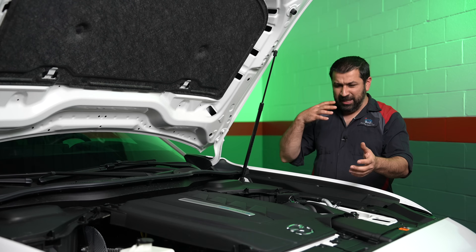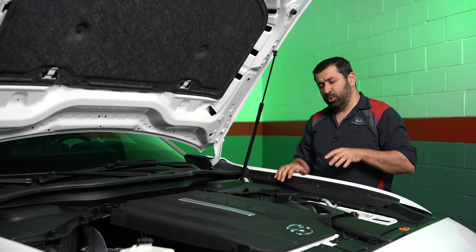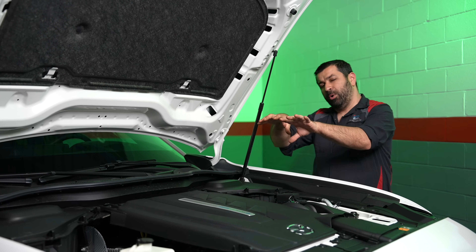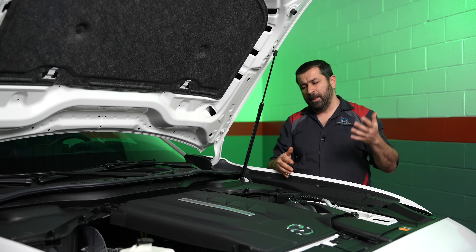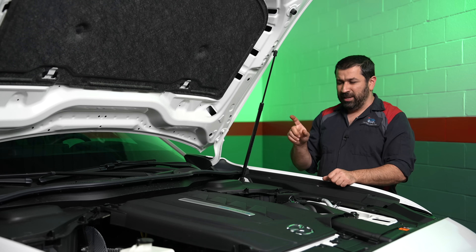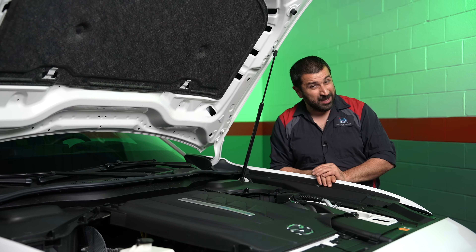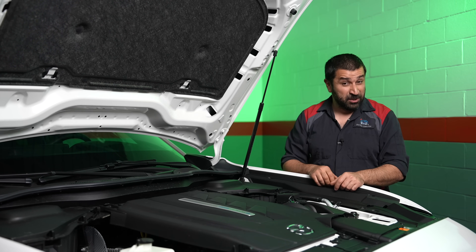Here's the cool part — let me dive into the driving modes. In EV mode, the engine is off and the battery is charged. The clutch between the motor and the engine disengages so the engine is isolated, but the clutch between the motor and the transmission is engaged, supplying power to drive the car. The coolest thing — something I don't see other manufacturers do — it actually starts shifting in EV mode through the eight-speed transmission. Instead of the engine driving the transmission, the motor drives it and it shifts, and it feels like a completely normal car. That is the genius of this system.